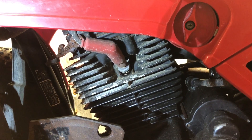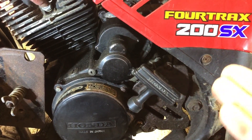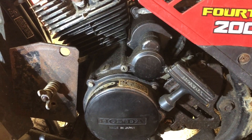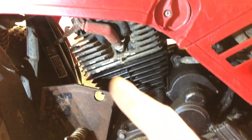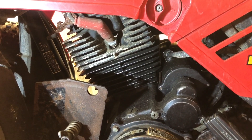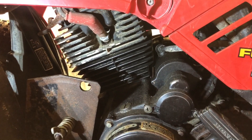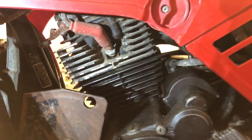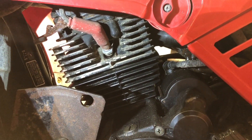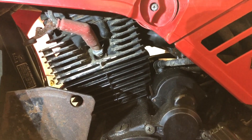This little engine is pretty powerful and the design is very unique. They didn't make anything like it after they stopped producing the SX, all the way up until around 2001 when they finally made the 250 EX. However, because of the unique head design, this thing is going to be pretty powerful. I wouldn't doubt it has quite a bit more power than a 250 EX — and that's simply because the 250 EX uses a push-rod design, whereas this head has an overhead camshaft.